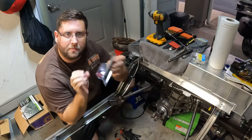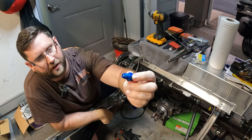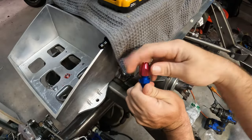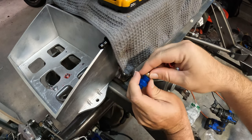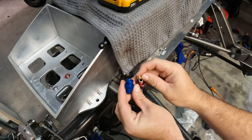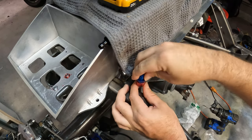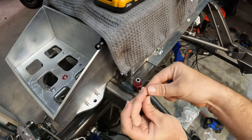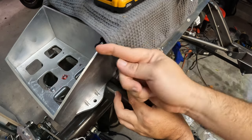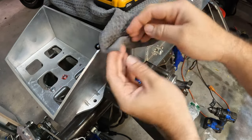There's nothing more exciting than finally putting that fitting on. We went with a quick-attach AN6 fitting that kind of self-crimps onto the 3/8 fuel line — a very interesting item. I was told by many that this is a super popular option for fuel lines. They're recommended against using with fuel injection, but people do it and it's working. Hopefully the angle here isn't too extreme, because I still have to come off with another 90 and then go down.